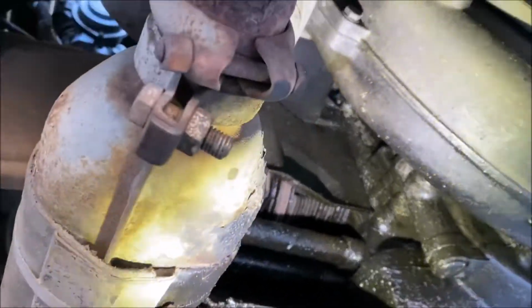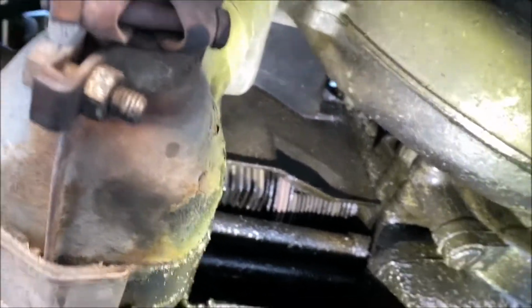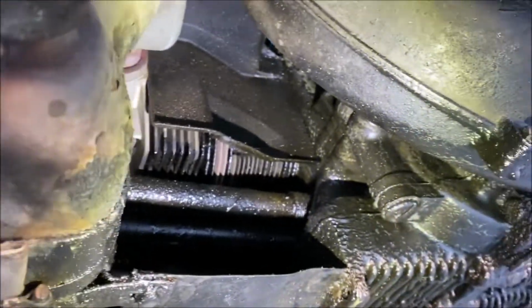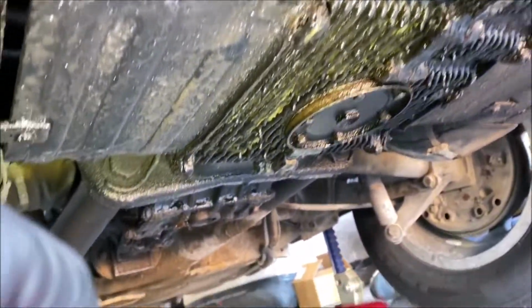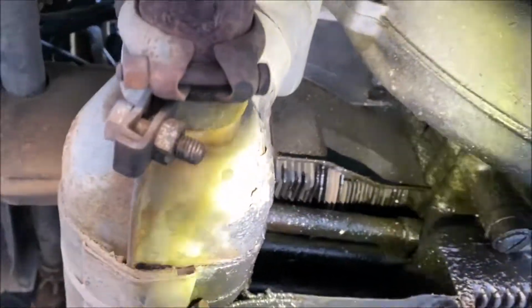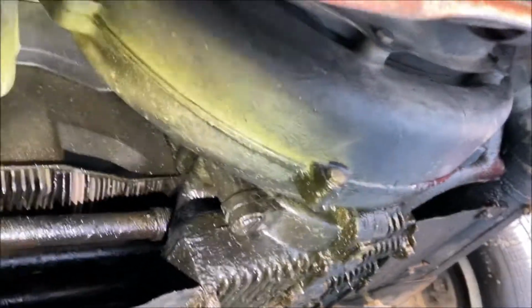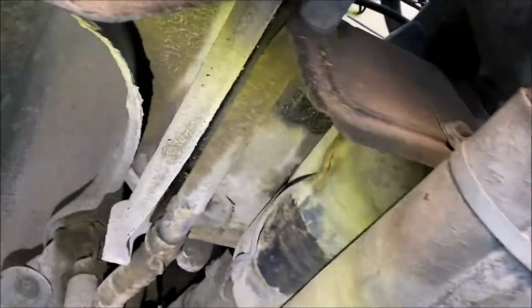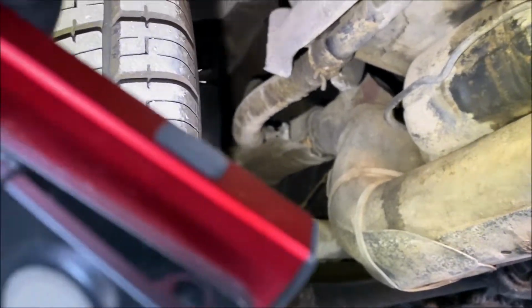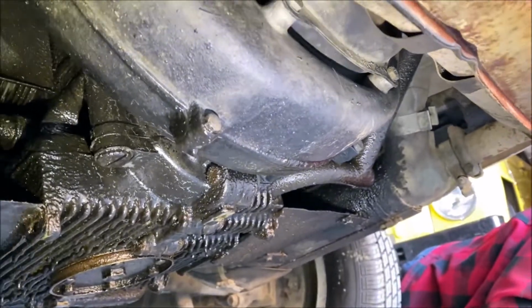I mean, you could see how bad the oil cooler is leaking. You can see it coming down the cylinder head cooling fins and the cylinder cooling fins, and everything is just caked. I don't know how much of that is just the oil cooler or how much of it is everything Volkswagen. So I'm leaning towards this actually needing to come apart, unfortunately, come out and at least get resealed.